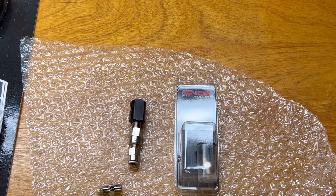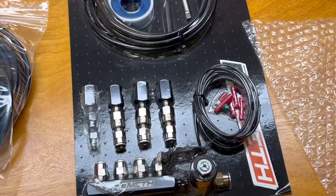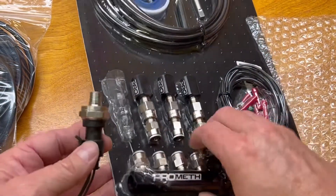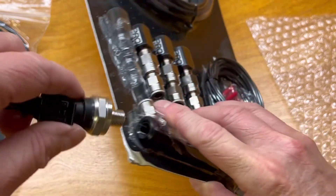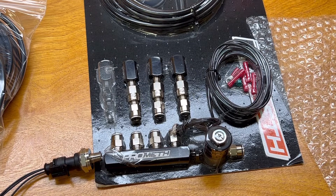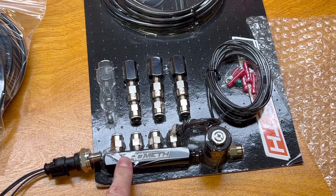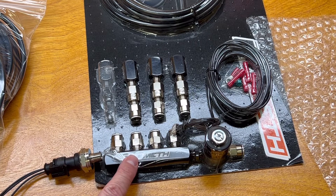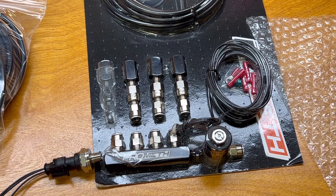I went to my guys at Ballinger Performance and asked what they recommend. I looked at flow sensors and everything else, and they hooked me up with this Honeywell 500 psi sensor — very reliable, very accurate, all stainless steel. The distribution block from Pro Meth has a port that comes with a plug; I removed that plug and installed the sensor to give me a pressure-measured system. If the pump fails, the solenoid fails, a line gets kinked or melts, and the system doesn't see the target PSI — say 300 psi from a 300 psi pump — I can scale back my boost target within the MoTeC, save the motor, and a flashing alert will appear on my screen indicating an issue with the meth system.